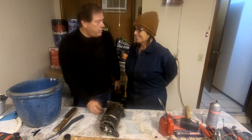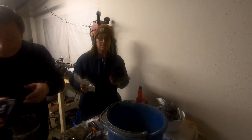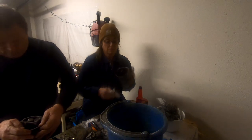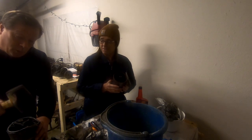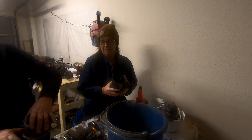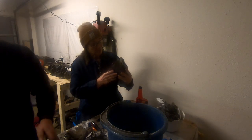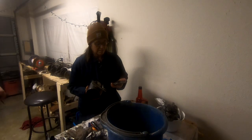Robber, why don't you show what you did today? I cleaned the oil filter up. It is a bypass oil filter — with older technology it only pushes about 10 percent of the oil through at a time, as opposed to today's oil filters that go 100 percent through as they filter. But eventually 100 percent filters through — better than nothing. Anyway, this thing was really, really nasty down in there — lots of thick gross oil — but I was able to clean it up decently.